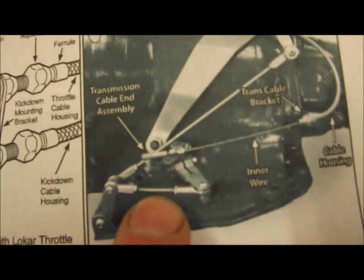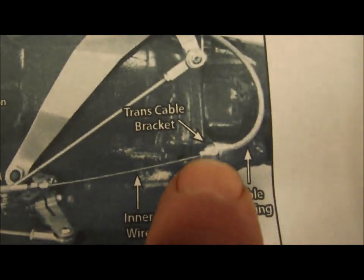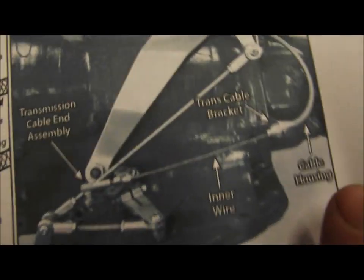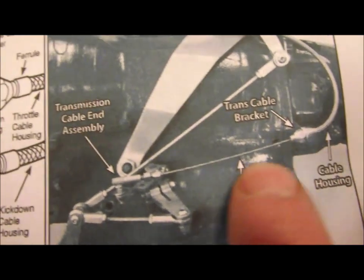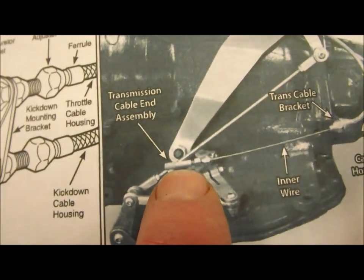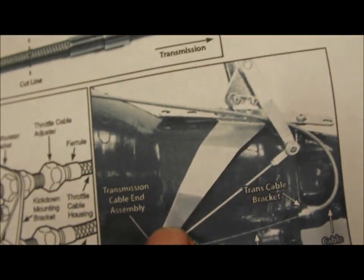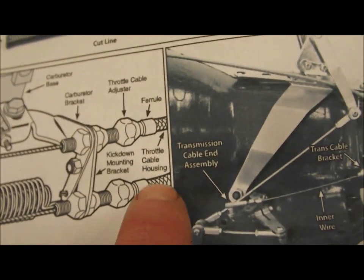Let me have a look. Yes, it's here. It's showing the cable curl around there on that little bracket. So that little thing there is basically this here. This comes round here on the flange at the back of the nose of the gearbox, and then comes onto this lever here. This linkage here is for a different transmission shifter. I've got a rod linkage going this way to the front of the car because it's a column change. That's obviously a floor shifter, it's shown.